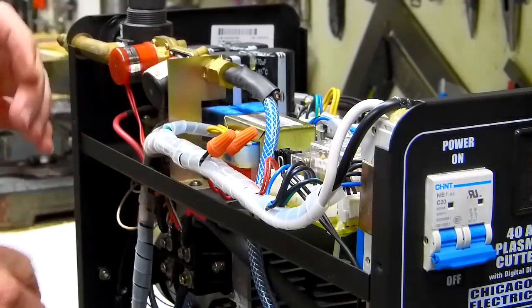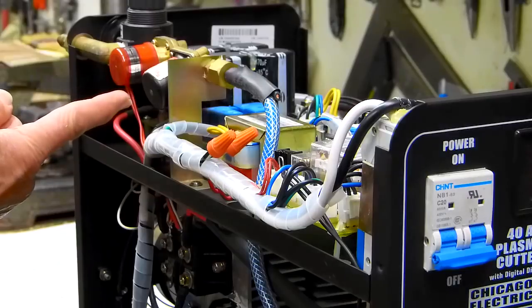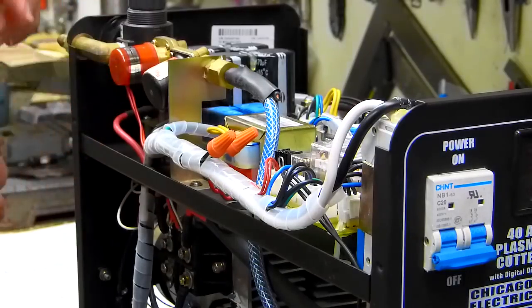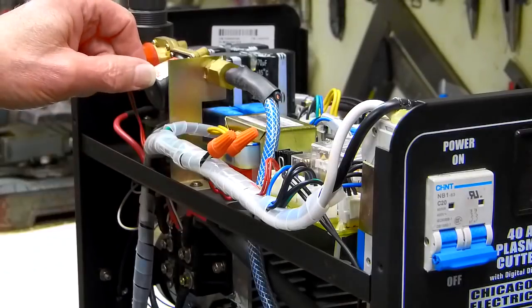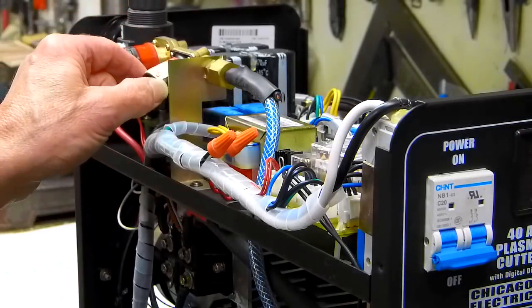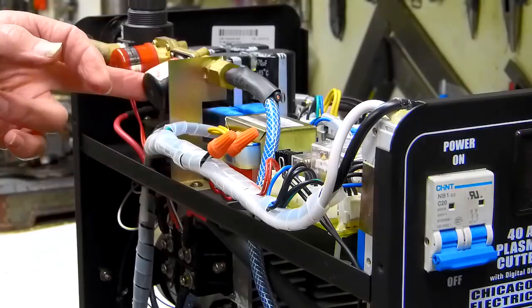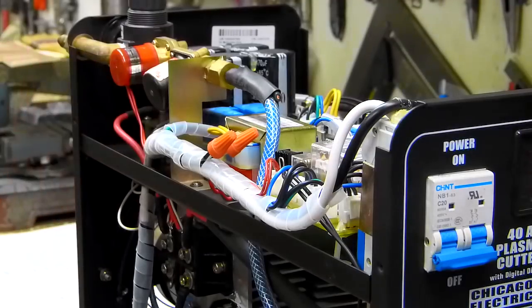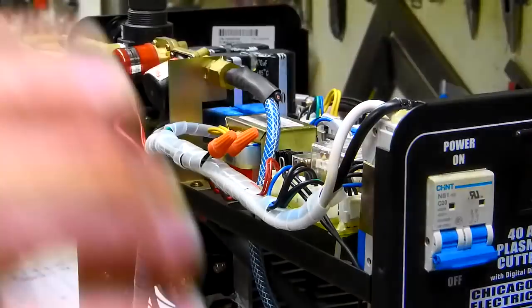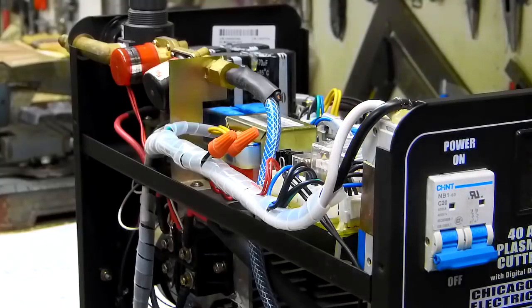I was able to take four screws out, pull that off, get the coil off, and just for the heck of it I unwound it. Interestingly, almost at the exact opposite end of that coil, the wire had actually burned open. You could measure the resistance and I was getting almost half a megaohm — like 500K. I knew that wasn't right. I was able to rewind the wires on that coil, put it back together, powered it up, and son of a gun it worked beautifully.